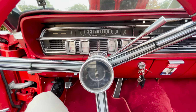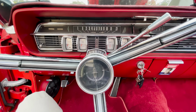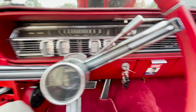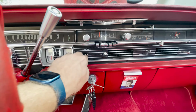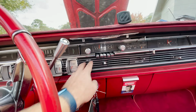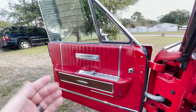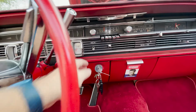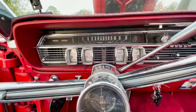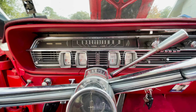Now, my understanding, or at least my experience with this, is if the car is off, I haven't been able to get the column, I don't think, to move up or down. There is a reservoir, and my assumption is very much like the door locks. The reservoir is there for that particular reason. Now, in my 64, very similar to this car, again, it wasn't running very long. I haven't really messed with this stuff too much when the car's off, just because my car stays inside and I'm not too concerned with locking it. But you'd imagine with the vacuum reservoirs, that's because you want to be able to do these things maybe before you start the car. So let me show you the video real quick. You'll be able to hear, hopefully, the solenoid activate, and that'll make sense, before the car was started after sitting for a week.